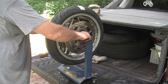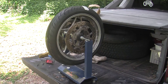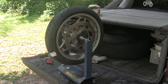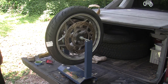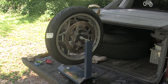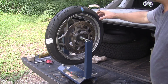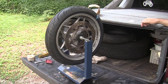Then put the shaft on top of the rollers and center the tire on the mark as best you can. Let the tire spin freely — no need to spin it, it will just drop. I've got weights on the tire right now; I did not remove the previous weights from the previous tire — I wanted to see how this thing actually worked. So now I'm removing the weights, which I would recommend you do before you try to balance your tire. The tire is gonna need weights — it's pretty close to the same place where the old weights were. The heaviest part of the rim and the tire is going to fall to the bottom.